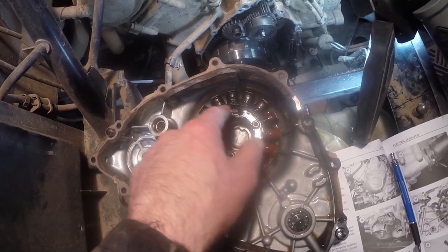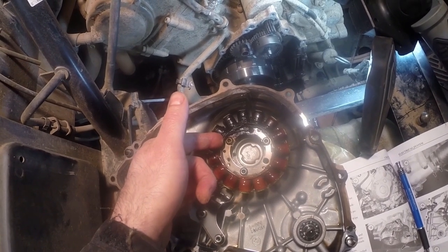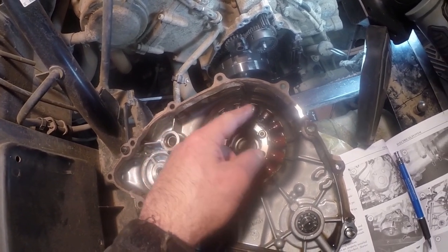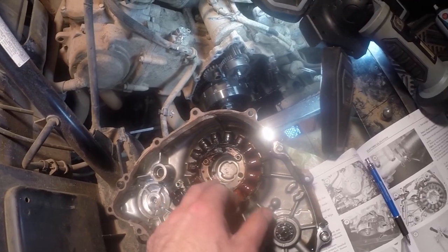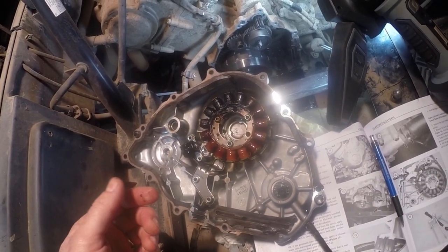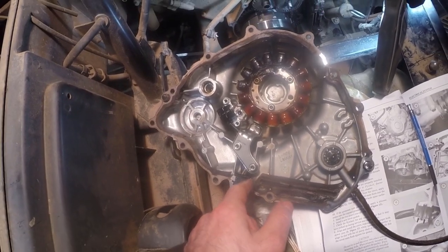You may very quickly observe that the stator is cooked - there was a catastrophic failure here. What I predict happened is the stator coils shorted, and then the whole time the engine had been running after that event, this area right here was basically a dead short trying to generate voltage over a dead short. There could have been very high current in this area - that's what caused the burn. Next steps are to clean the gasket surfaces off the case and cover, take these bolts out and change the stator. There's also a crank position sensor that came with the new stator, and this rubber sealing grommet has to come out with a bit of sealant going behind it.